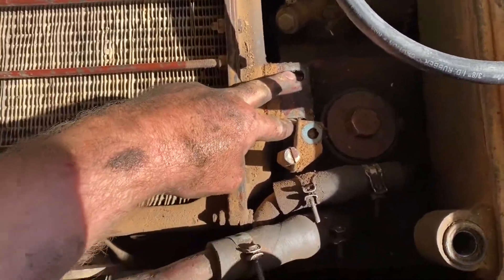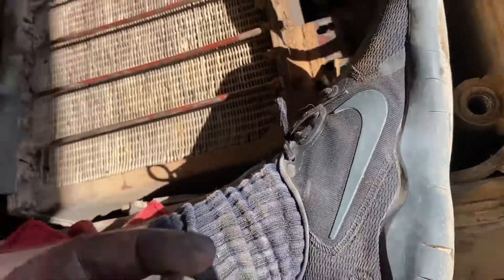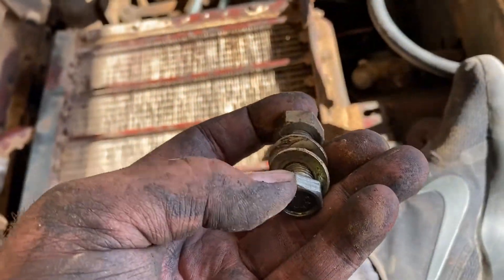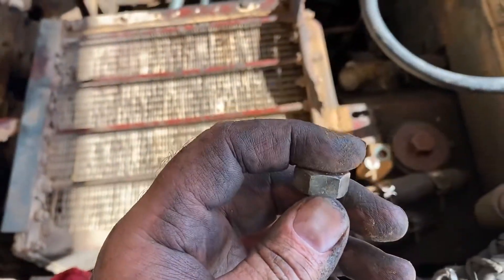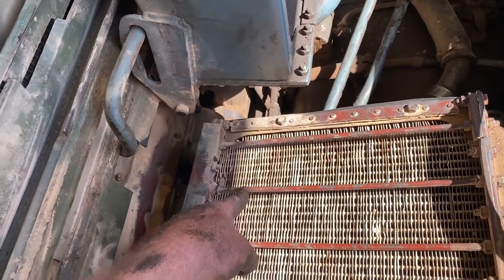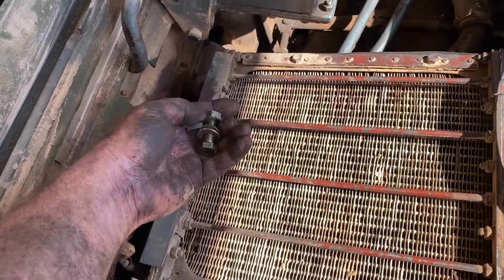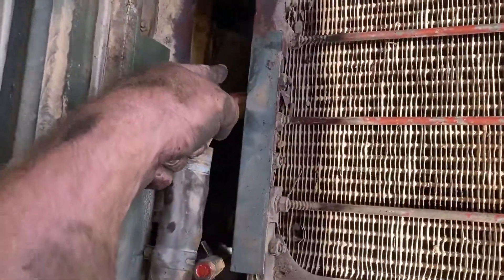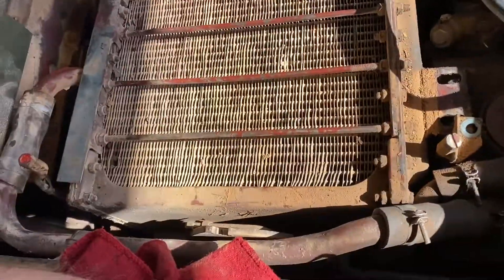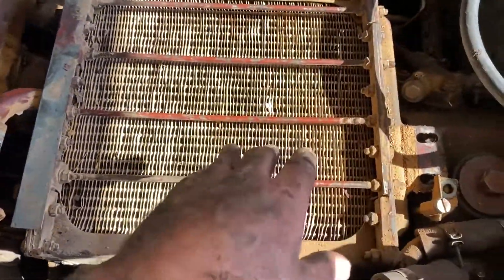The mounting brackets are here and here on the side. Down in those brackets you've got to pop those bolts off — that's a 17mm on that side, and I just use a crescent wrench to hold the outside. That's a bit of a pain because you have to have one hand on the 17, holding the end of it, then loosen it up on the other end. Joseph would have probably been better at that than me because I've got these big fat ogre hands.